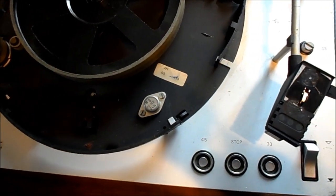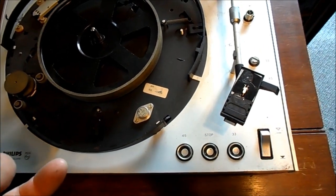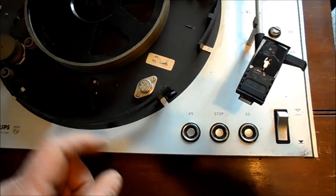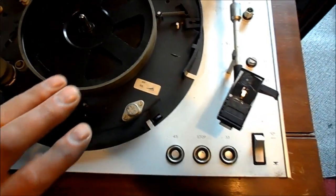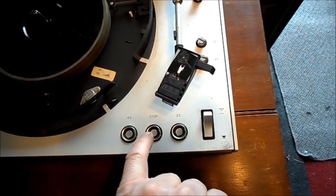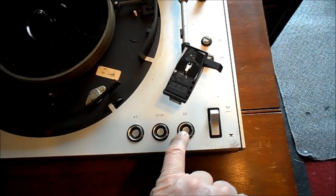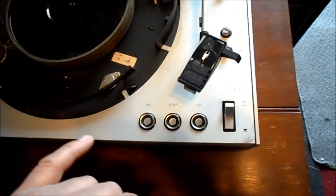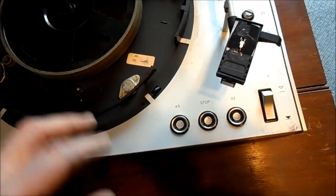This is what takes me back to what is wrong with my current one. I'm going to use this donor machine to figure out what's wrong with the one I own. If you look at a video I did some time ago — one of my first ones was Dean Martin's 'Let It Snow' playing on my other turntable like this. What that turntable does: initially one of the bulbs was blown, and you need these bulbs — they're an intricate part of the circuit and draw a strange milliamp value, something like 600 milliamps. The bulbs have to draw the right amount of current for you to change the speeds and have the circuit work. It won't work without the bulbs. There's someone on eBay that sells them, but I just found some cross-reference lamps to put in there.